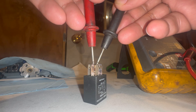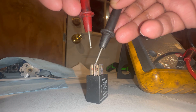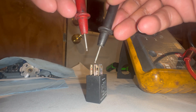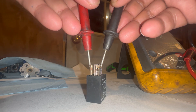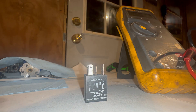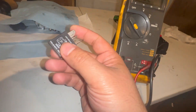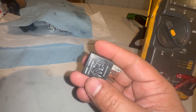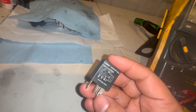These two right here are common — if this has positive, this will have positive; if this has negative, this will have negative. They will complete the bridge. These two contacts should be open loop. This relay is perfectly good to me. It just came out of a vehicle that was being junked, but we keep relays.